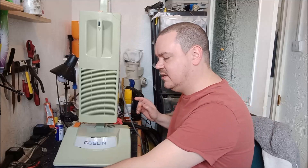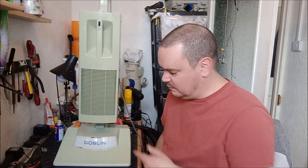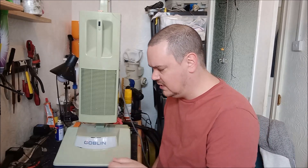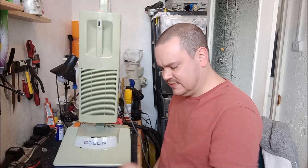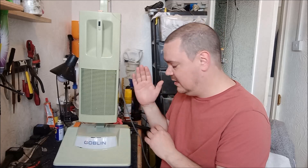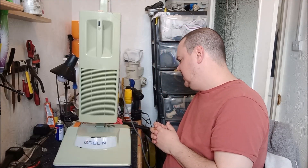I have memories of working on these cleaners. It's been a long time — probably 27, 28 years — since I've actually been inside one of these. This one does have a few issues. There's a rattling sound when you actually use it to clean, not just stand it up and run it. Also there's something a bit odd going on with the ratchet. If you push the dust box forward, the machine goes past the point of being held upright, so it leans forward. I noticed the chassis is a little bit damaged underneath, which is probably why that's happening.